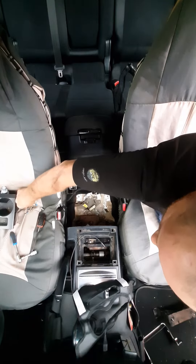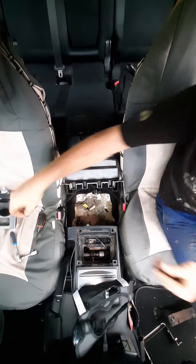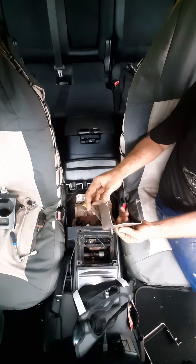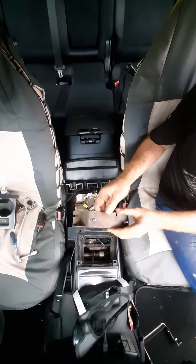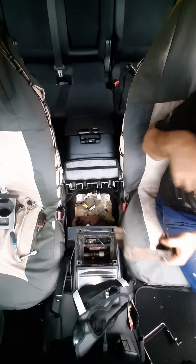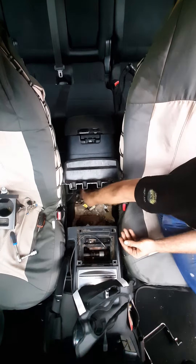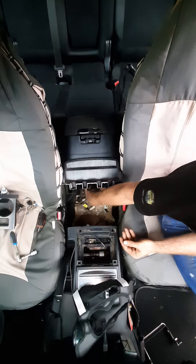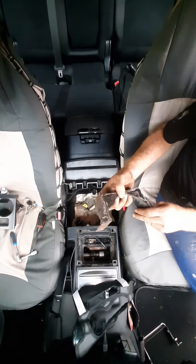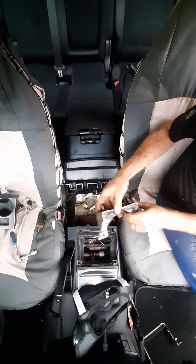It goes in the bottom and is only attached by two little screws. So I quickly fabbed up a bracket — probably two or three mil steel — and welded some bolts through it. I can attach that with washers and lock nuts, and it's quite a lot heftier and stronger. That should sort out the rattle of this big boy.